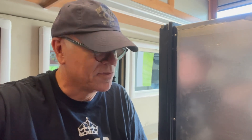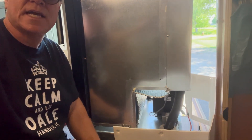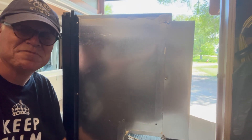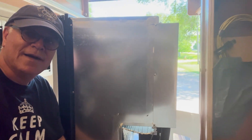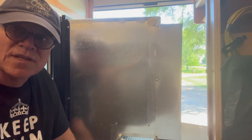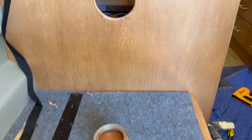I'm back in the van again - it's about three days later since I pulled the fridge out. I've spoken with the folks at Novacool, and Jim has been very, very helpful. He's had me run the fridge for the last three days to see if I can recreate the problem. Sure enough, the fridge is working great - it's cold and it's running well. So I got talking to Jim and I'm of the theory that since none of the connections are loose, it has to do with ventilation. I've added this hole that I cut into the side cabinet, used a little bit of stain to try to match it, and I'm going to put a little bit of screen on it to make sure nothing ever falls into it.